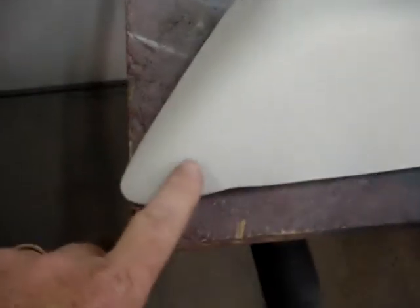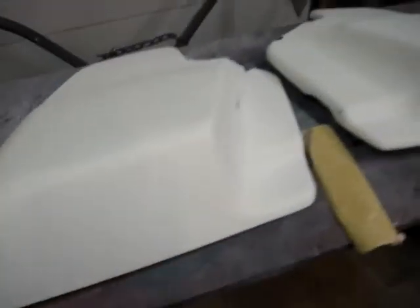Yeah. You can see a lot of times what happens is they get over tightened. When they do, it causes the surface to spider crack. Lo and behold, exact same thing over here. If I can find it in the viewfinder there. Where's it at? There it is. Focus, there it is. Both sides, so we'll have to take care of that. We'll sand into this a little bit, put a filler on that crack. Try to strengthen that up some so it doesn't come right back.